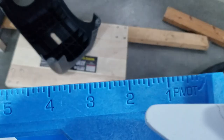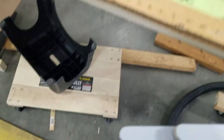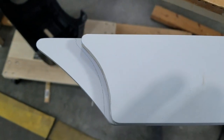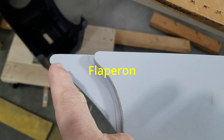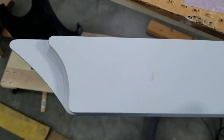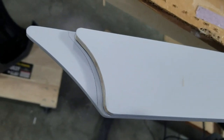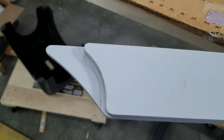You're taking off approximately close to two inches there. That will allow your ailerons to fold up, so when you fold the wings you won't be running into it — otherwise this will dent your ailerons. So heads up on those before you paint them. I had mine primed before I found that out, but at least I didn't have them painted yet.